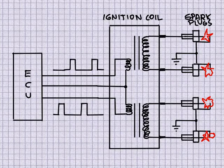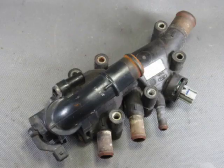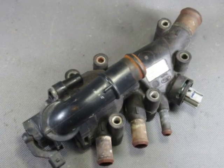What caused this leakage? It turns out that near the coil goes a hose from the thermostat housing to the heater valve. To relieve the strain on the hose coupling, they designed a steel support attached to the engine block, which happens to be electrically connected to the ground of the entire car, unbelievably close to one of the high-voltage terminals.